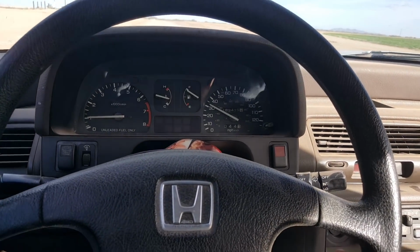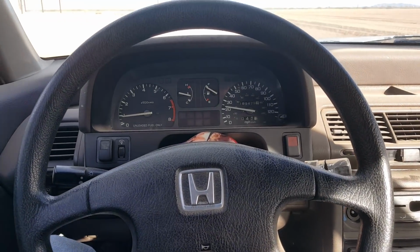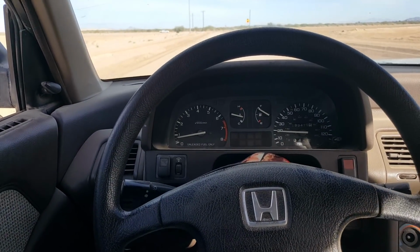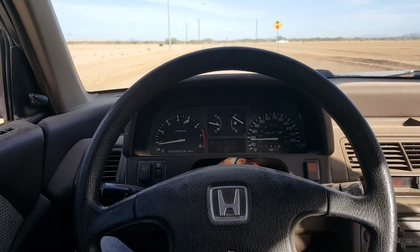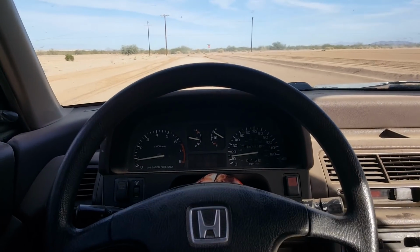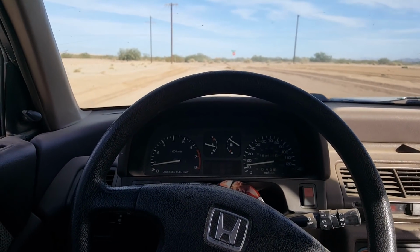So that was a little, I know my speedometer's off because of the bigger tires. That's like a little 0 to 60, nothing crazy. Occasionally the check engine light will come on if I do a pull after I've been driving it. That's why I made this little video, because right now it came on because I've been driving it. I'm pretty sure it's the fuel pressure. It's running lean. I think that's why it's coming on. So I might have to put a bigger fuel pump, but that'll be in the future. Should be good for now.